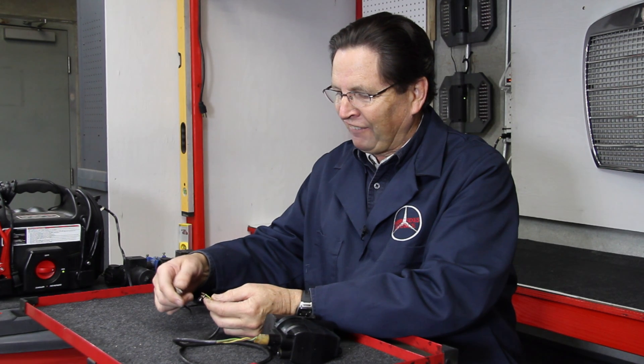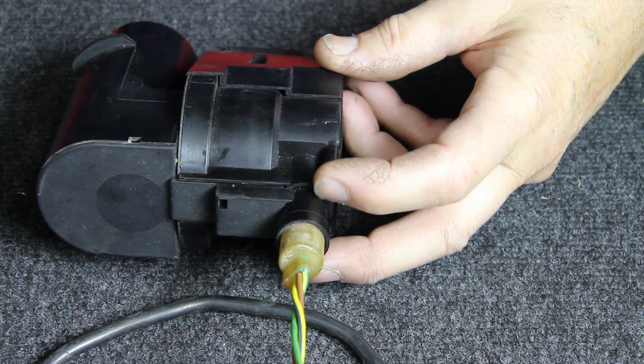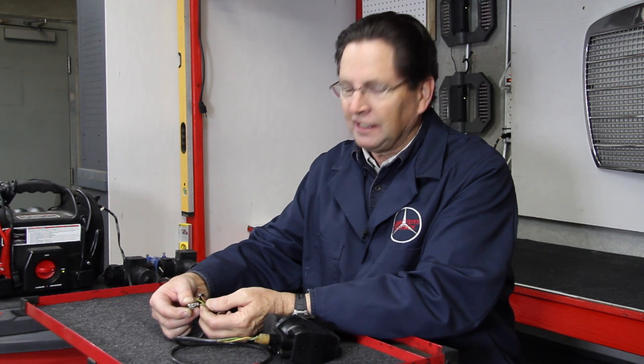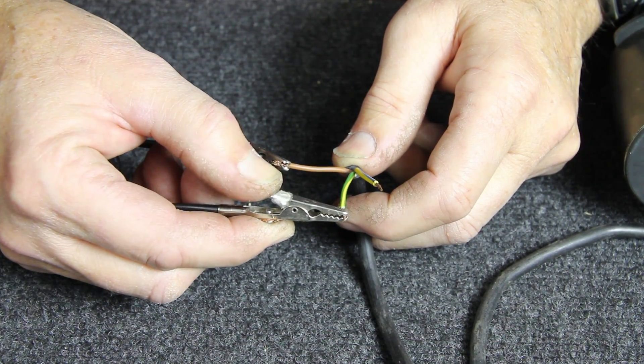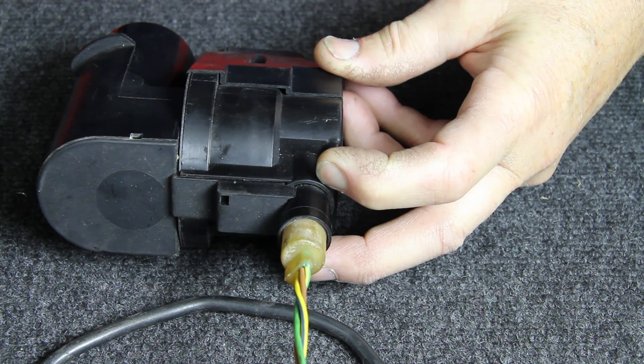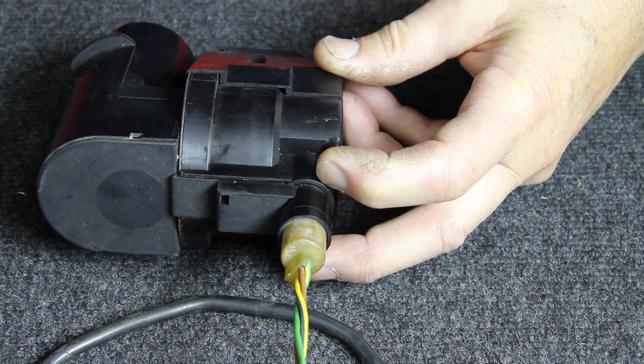Watch this — if I connect this and let the pump run, I take my finger and go over to the vacuum plug here and close it off. Notice the pump ran and then stopped. Now that flips the switch inside this pump, which will allow it to run the other direction. But if I go back to the green wire, it's not running. So when testing the pump, you have to go one direction — you can feel it's blowing air right now. Hold the finger, it shuts off. Go back to the other wire, run the pump — now I can feel it sucking air. Hold my finger on the end and it shuts it off.